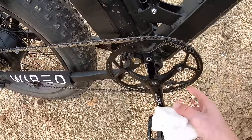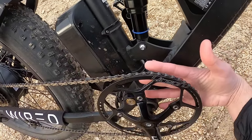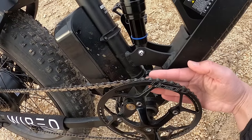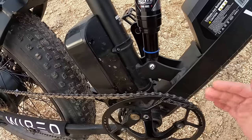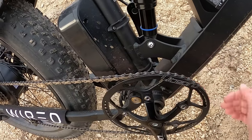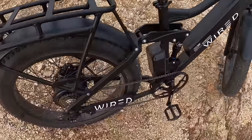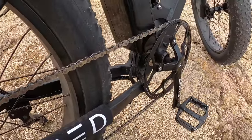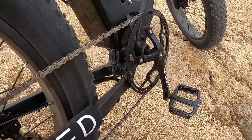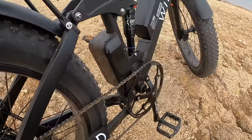Another option would be to put one of these covers like this guide on the front of the chain ring — put one on the back side as well, so it has a little protected ring around the back to keep the chain stuck in between and prevent it from hopping over and dislodging. Another thing I've seen on other bikes is a big piece of clear plastic that would go behind it and stick up a little bit, preventing the chain from being able to jump off the chain ring. It would bolt into the back side of the chain ring and keep it from coming off. Just kind of annoying when it happens, but not necessarily a huge deal — it can happen on any bike. I've had it happen twice on this one.